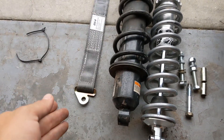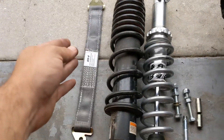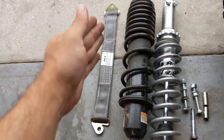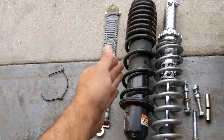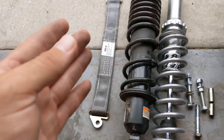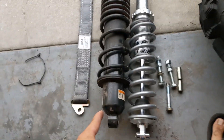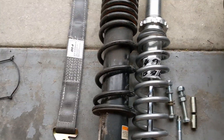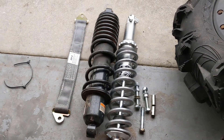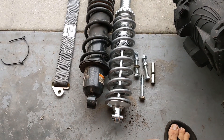These things are rated pretty well, and I think it's based on ignorance because no one's actually done a comparison — like, look how much down travel I'm losing. It's really simple: you can't argue with this. If this shock is the member that limits down travel on the stock suspension and you want me to replace that limiter with this strap, and this strap is shorter than this, I'm going to lose down travel. At full down travel, the weight on the bike is irrelevant — what limits the travel is the length of the shock or the length of the strap. You're losing a significant amount of down travel front and rear. This is a high-performance aftermarket shock setup — you should be gaining travel, not losing travel. That's pathetic.